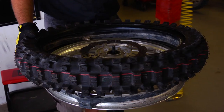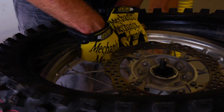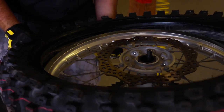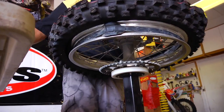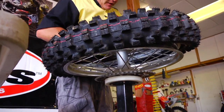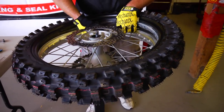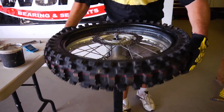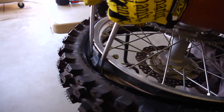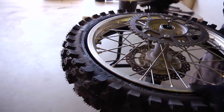This tire is not directional so we just go right in either side. Now I put the valve stem through the hole in the rim and I'm going to thread the nut on about three-fourths of the way or so. Then I feed the tire on — I'm feeling underneath and I can feel that the tire is underneath the tube, and I'm pushing the tire on. I'm taking bites now, lifting up just a tiny bit. My last bite I can pull up and I'm in. Now our rimlock is stuck on the wrong side, so all we have to do is get our spoons, hit that rimlock down, pull it up — rimlock moves nice, let it right back down.